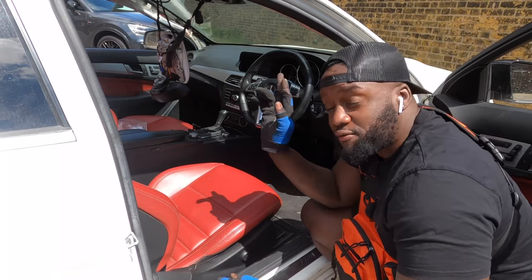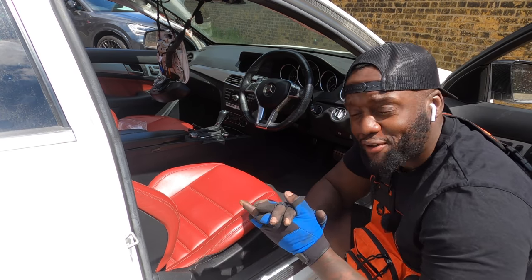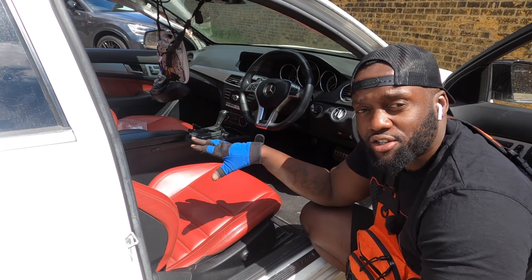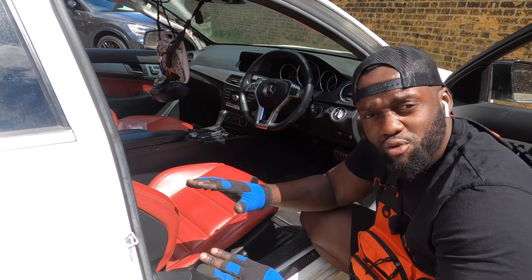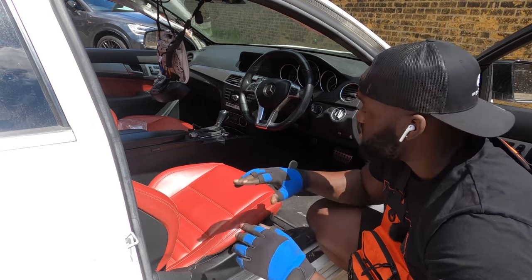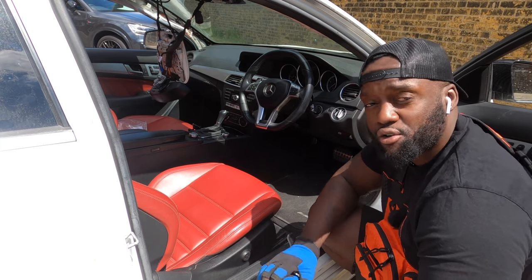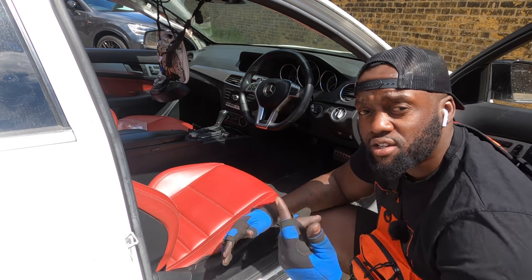I've just taken the car for a short test drive around the local area. I'm happy with the front belt — the auxiliary belt is fine, it's not running off, and the engine is working fine. However, there's a lot of power and no traction control whatsoever because the system's down. I don't want to do any more driving until I sort out the traction. In yesterday's episode diagnostics showed an internal fault with the steering angle sensor, so I'm going to remove the airbag, remove the steering wheel, and get to grips with it.